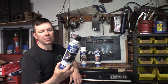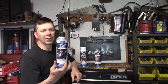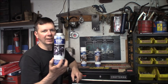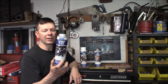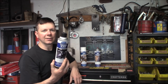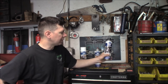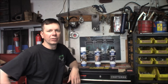The chassis black I've just applied to the frame. It's looking like it's going to be a nice, durable coating — it hasn't fully cured yet. It says 4-hour cure, full cure time 12 to 24 hours, and if it's below 70 degrees it takes a lot longer. I tried some on the frame earlier when it was only about 62 degrees in the garage and it took well over 24 hours to fully cure. Today while painting it's about 75 degrees with a fan blowing on it, which should help it cure a lot faster. Like the picture on the can, it does make a nice satin black original chassis look.